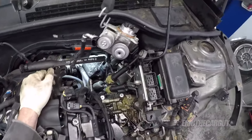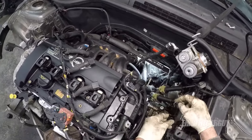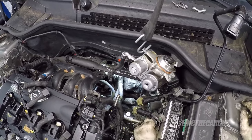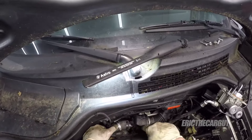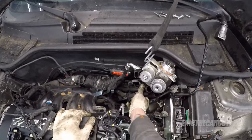There is one connection for the clutch hydraulics there. There's also an electrical connection here which I'm going to get rid of right now. Now, because these retainers can so easily go missing, first thing I do when I disconnect them is I'll just put the retainer back in. If this socket doesn't fit, I'll be very disappointed. It doesn't really fit. I'm going to use it anyway. Yeah, it worked. That looks like everything the clutch hydraulics need. This is a seven millimeter. It might get messy. It's not too messy. I'm good with that.